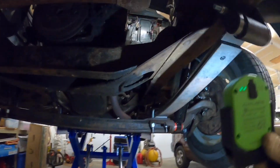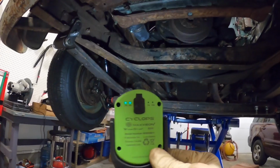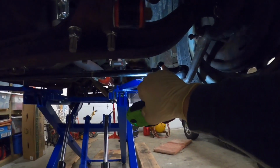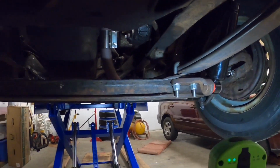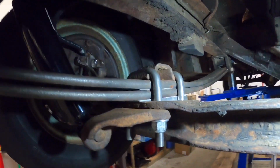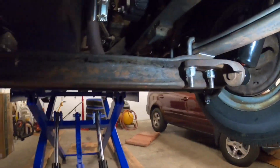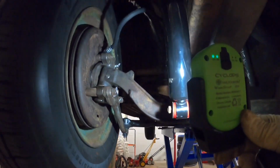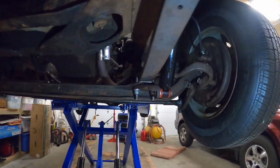Well, we got everything buttoned up here, cotter pins in. There is one more thing that I have to do, and that's tighten. I want to double check my tie rod end bolts there, but came up on the U-bolts, and it looks like the shims, 4-degree shims, are seated nicely in there, and all the bolts seem level. And they're nylocs, so hopefully they're good and tight. I checked everything over here. I guess we're in pretty good shape.